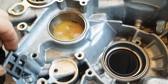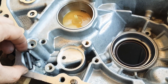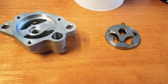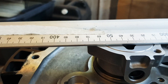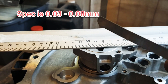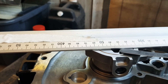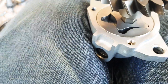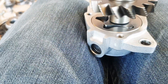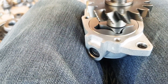This little magnet goes in to collect any iron filings and residue from inside the gearbox — it sits on the bottom of the oil bath. Here I'm clearancing the oil pump, making sure the surfaces are nice and flat using a flat bar, and then measuring the tolerance between the oil pump housing and the rotor — you're looking for a really small gap. This is the oil pump and its drive gear. That little gear is driven off the diff ring gear, and that's what pumps the oil around the gearbox.